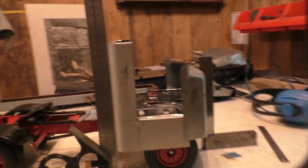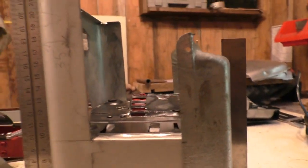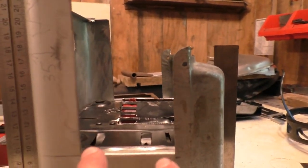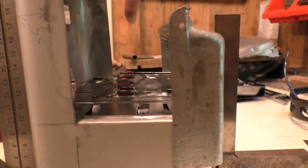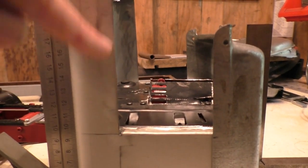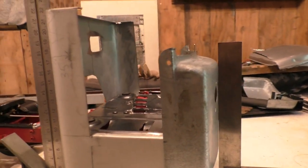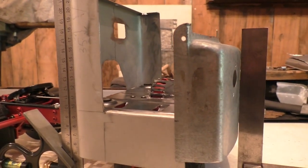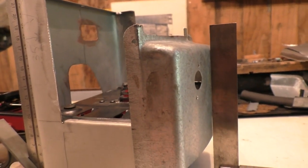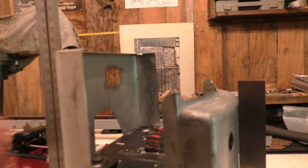I put the cuts in and folded them down so it's like little rockers there now, so it's all good. The gaps are pretty close. I've got the squares here to keep the front straight and the back of the cab straight, and measured the door holes. The far side is 70 at the bottom, 70 at the top. This one here is about 69 at the bottom and about 68 at the top, so this is square. What I'm going to do is shave this to get this cavity 70 wide, top and bottom. I'm just thinking about how I'm going to attach these things and make them removable. I need to do the big old chrome grill that these things have, so I don't want to attach this yet. I kind of want to tack it in so I've got one solid thing and then I can build around it. When it's all loose it's very tricky.